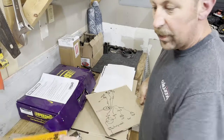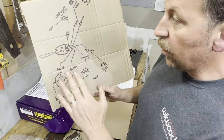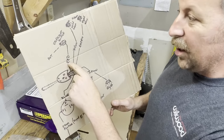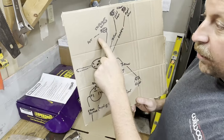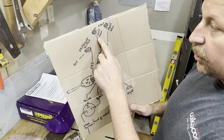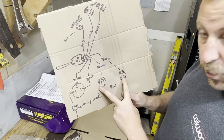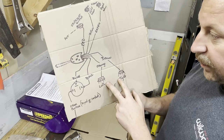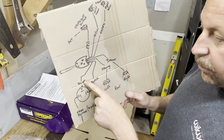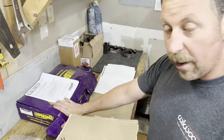I'm going to show you exactly how to wire this in to make this generic switch work. On the back of the box on these kits there's a little wiring diagram — kind of hard to see, so I drew it out a little bigger. Here's your switch: the red wire goes to your stoplight switch, the yellow wire goes to your left front turn signal, the green wire goes to your right front turn signal, and then your brown wire and orange wire are at the rear of the car for your right and left turn signals respectively.